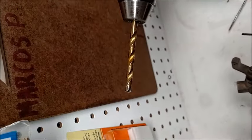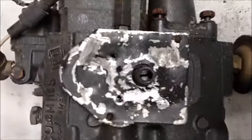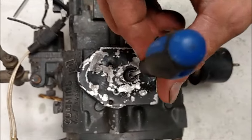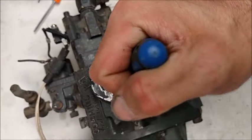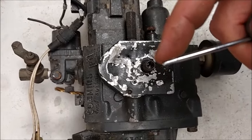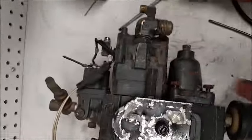Finally, I threw a bit in my cordless drill that's the exact same size as the big hole, and that's what it took to finally get that thing out. And as you can see, right down in the hole here — we're looking through the camera — there's a flathead screw. Put this in and turn it counterclockwise, and as you do that — yes, I even broke a pick — there's a needle valve down in there, and as you screw it counterclockwise, just like a regular bolt, it's pulling it back.